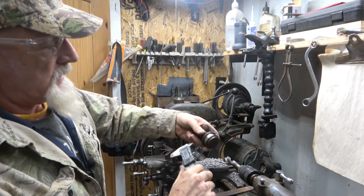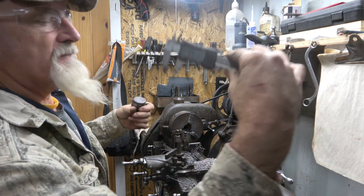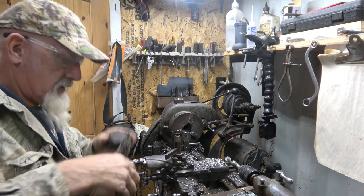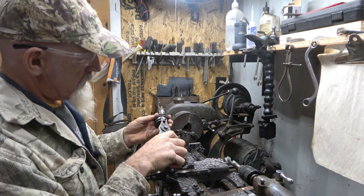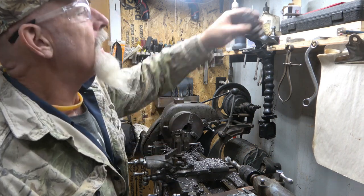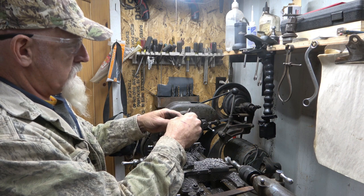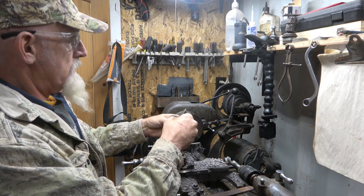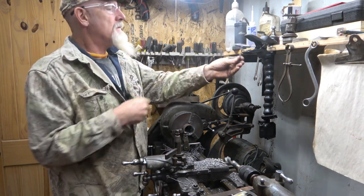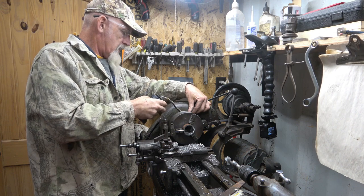See what we need. There, snap ring on will kind of tell me where I gotta be. 5.470. Okay. Take that back off. .470. All right, that gets you up there. Make a mark around there so I know where I'm at. Get close. That way I can see it on the lathe when I'm spinning it, and I won't go over. All right, now cut this. I'm gonna cut some pieces of this. Better fill my caps.